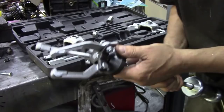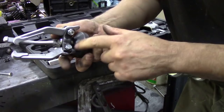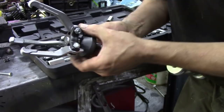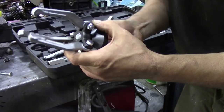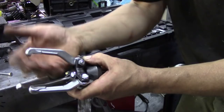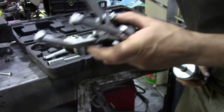I've set this up as a gear puller or a pulley puller. I've got this cone on here — what it does is act on the ends of the legs, so as you're tightening it up you can see the legs getting tighter and tighter. You can adjust it and get it really tight around that gear, because a lot of pullers are no good — the legs bend and one drops off. Give it a couple of taps and off that gear will come.